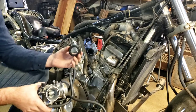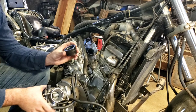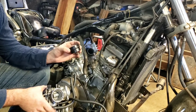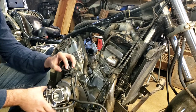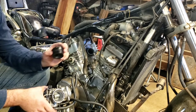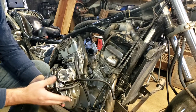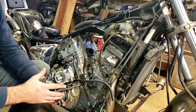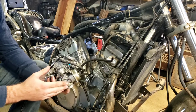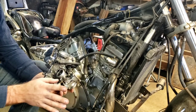This one is actually going to take us a lot longer because the little nipple that shows you where to line it up got broke off when I took it off there, unfortunately. So we're going to have to do a little tweaking to make sure that's in the right spot. I think I found where it's supposed to be, and I marked it with a Sharpie to allow me to coordinate that. We're going to see where exactly this is going to line up in just a second - let me go get the Vaseline and we'll get these throttle cables and stuff put on here.